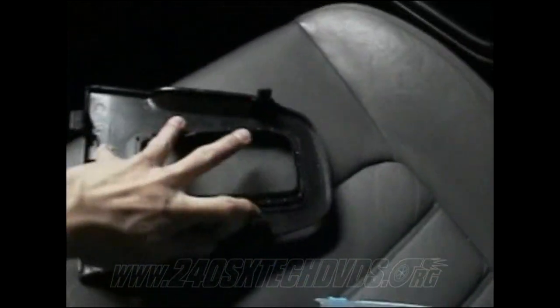When you're going to remove your center console and your automatic shifter, you have two screws to remove right there in the little compartment. Then after you pull your plate off, you just pull up on it. It's got these two little clips on the back side. You see that? Yeah, there's two clips right there. And the other two are just flipped up. Mine's already broken off on the end, so be careful not to break those clips off. Of course, you're not going to use this one anyways because it's automatic. The 5-speed has a different one.